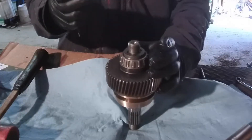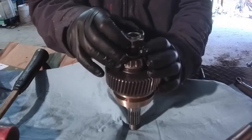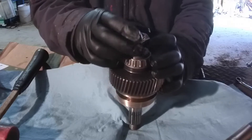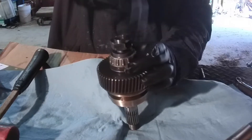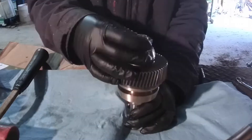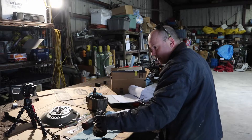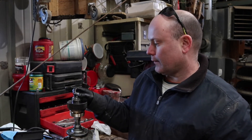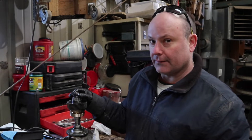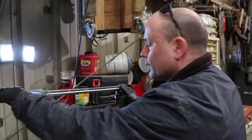Now the collar goes on so the spinning won't affect the nut. The next thing is the nut - this is the new one. Remember: reverse threads, so we're going to turn left to tighten it. Then over to the vise to torque the nut. The book says to torque this to between 60 and 80 foot-pounds. Left-hand thread, so turn left to tighten. I'll go for 80 foot-pounds.